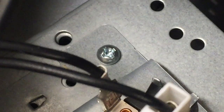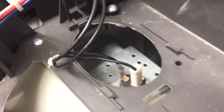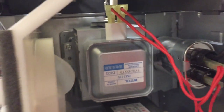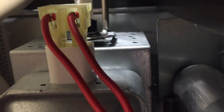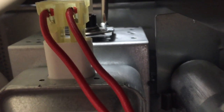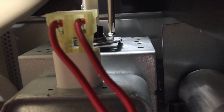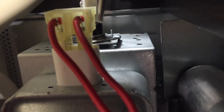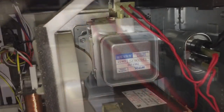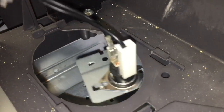Next there's a little cover here that we can take off — there's a screw in the top right here going to the top of the magnetron, so go ahead and take that off. Here's the magnetron itself. We're going to get in here and take that screw out through the top where we removed the cover. That just takes the top bracket off and makes it easy to get the magnetron out without having to unplug a lot of things. If you have a magnet to grab these screws, that's good. Just be careful that you don't touch the wrong things. This comes up out of the way and is free.